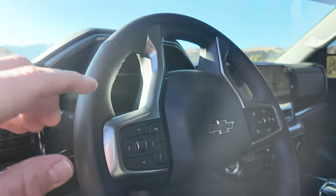So this is a turbocharged motor. Does it do really good at altitude for you? Oh, it does great. Okay. Yeah, so I haven't noticed any turbo lag or lag in power going up through the mountains. So that's one of the biggest features with a turbo versus a non-turbocharged motor. At altitude up here, you have power loss in a non-turbocharged vehicle. So some of these Super Duty trucks, or like in this truck specifically, you would have the 5.3 and the 6.2, which are not turbocharged, and you will find that there's a power diminishment when you're driving in the mountains and at altitude.